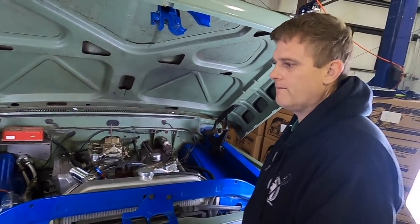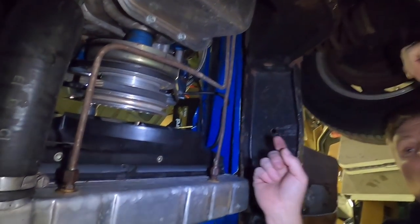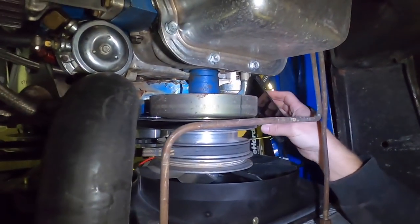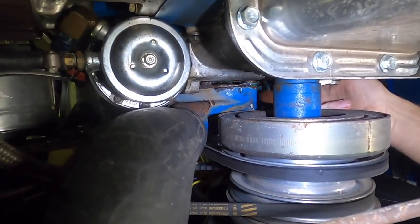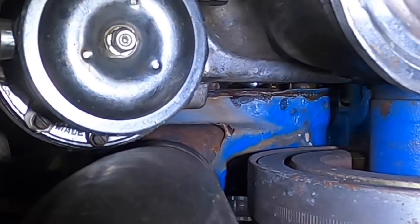We're moving under the vehicle — the truck's too big for Matt's lift so it's up on jack stands. Under here I don't see many additional leaks. There might be a little water pump leak, but it's directly below the thermostat housing we know is leaking so we'll do the thermostat housing first. Actually, looking closer — that light there, that's a separator plate gasket on the back side of the water pump, and that gasket is definitely leaking coolant. So we're doing a thermostat housing and a water pump.